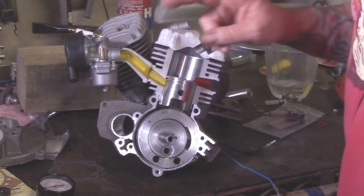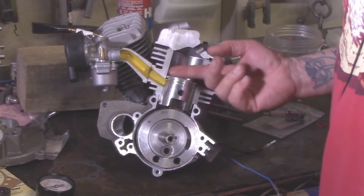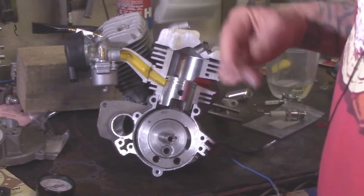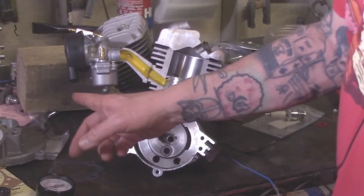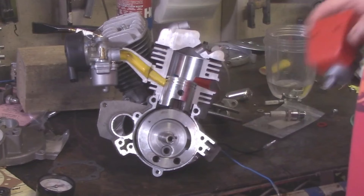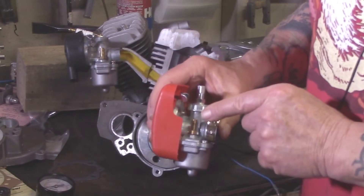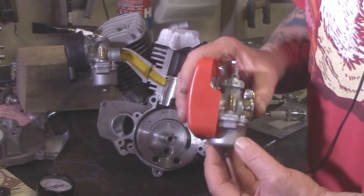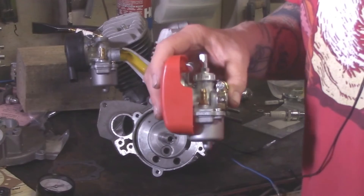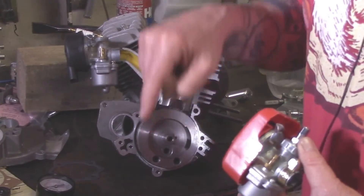Let's talk about what to look for in the sucking realm. You've got two areas that can be a problem: either we're not sucking in any fuel or not enough, or we're getting too much. If we're getting too much gas, we'd have a very wet spark plug — pull it and it's got a lot of gas on it. You may also have gas dribbling out the back of your carburetor or air filter. That's a pretty easy fix — most of the time the problem is your float inside the carburetor. If the float is filled with gas instead of air, it can't rise to shut off the fuel. Clean the carburetor — I've got a link to a video in the description.